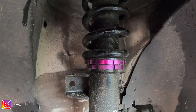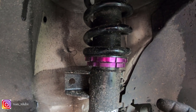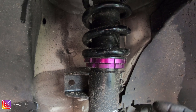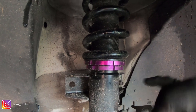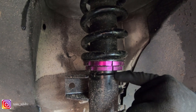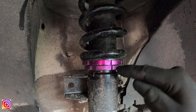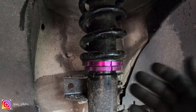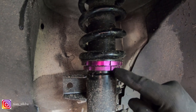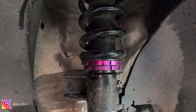It's positioned underneath the top locking nut. It's quite a simple process. Obviously if you're going to adjust both sides or all corners of the van, you're going to need to measure. I've gone from this little ridge in there — I've got about six or seven millimetres gap between that ridge and the bottom of that adjuster on both sides. That way, if you want to lower it slightly more in future, you can release that off and lower the top nut down.